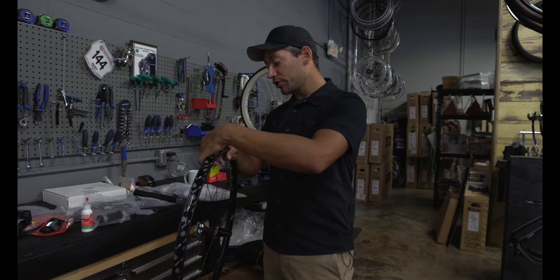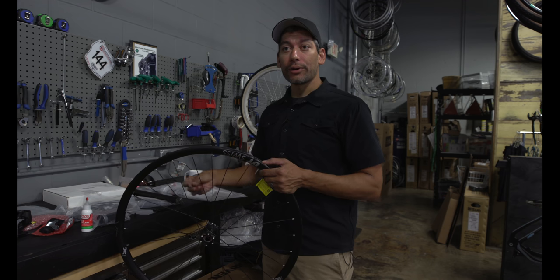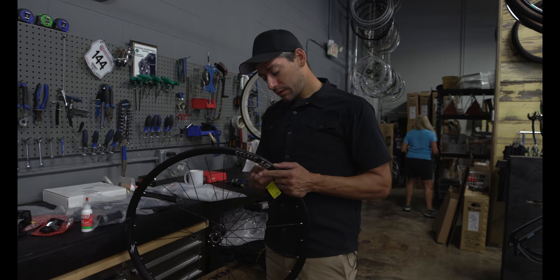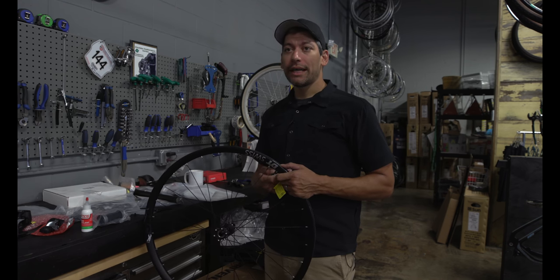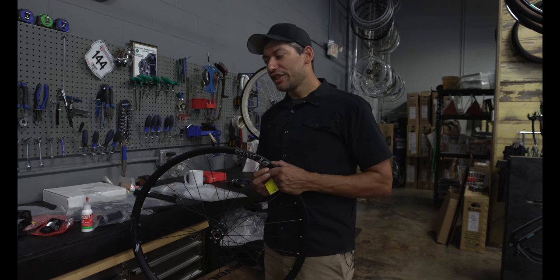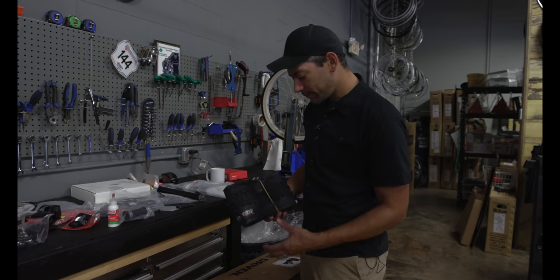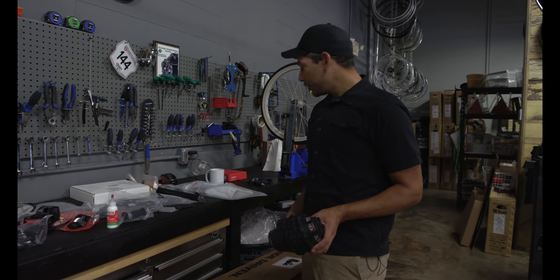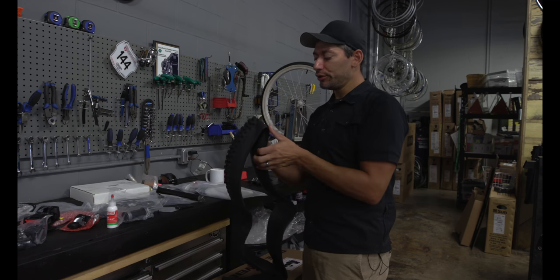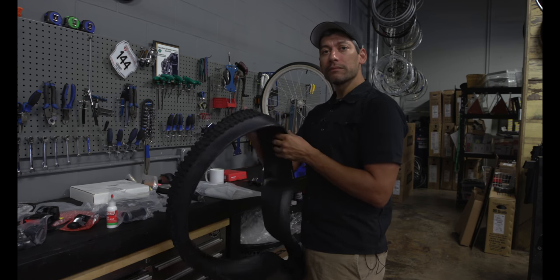You can still get a puncture through your tire. You pick up a piece of glass or a thorn or anything like that. There's no perfect system. Hopefully if it's a small little puncture, the sealant will get it, and then you can fix it later. But if you slice a hole in the tire, you're screwed. You can use a tire plug system sometimes if you're out in the middle of the wild. So I should be carrying like an inner patch type? You should carry a spare tube. And a CO2 inflator, maybe a pocket pump. Yeah, I have a Crank Brothers pocket pump.